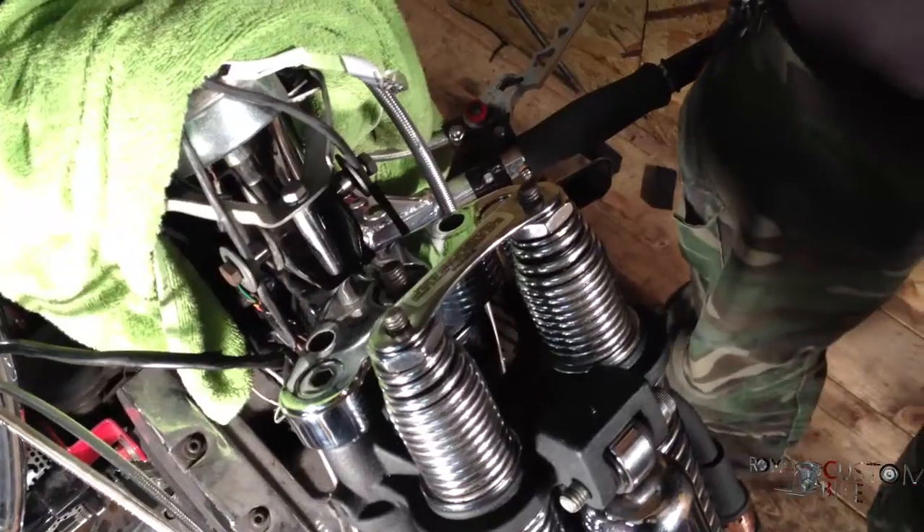Here is the original HD part. Initially I thought I'd replace it with a piece of aluminum and copper, but I realize that this piece is incredibly hard, so it must be some kind of tempered steel which I'm not able to replicate. Since this piece is a structural part that influences directly the mechanics of the steering and consequently the safety of the driver, I've decided to build my piece around it.